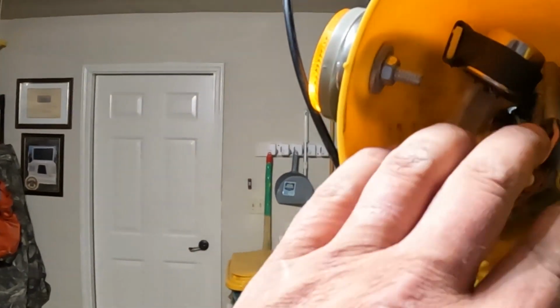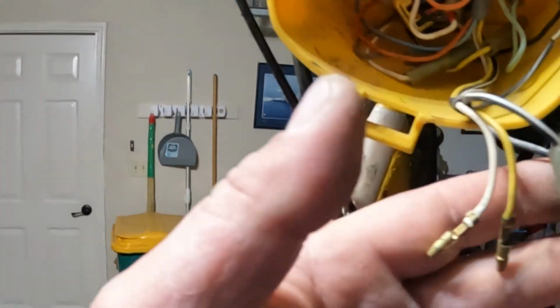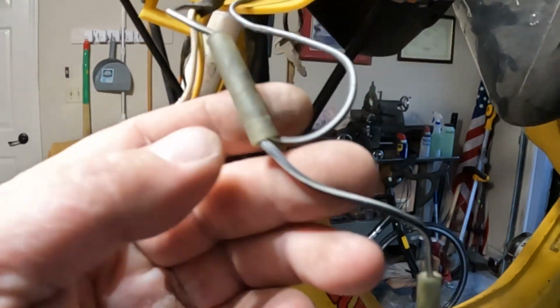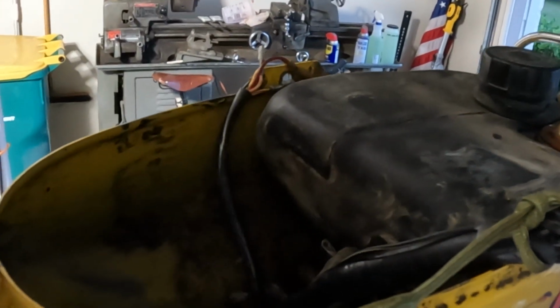All right, I got everything hooked up in here inside the headlight bucket. Hopefully all those connections are good. That's the turn signal relay. Headlight will get hooked up to these wires right here. I did find the ground. It was just a little pigtail that was on the other one. Everything back here hooking up is just plug and play. It all just plugs in. There's nothing fancy going on, but you're all gonna have to find out about that in the next video. I'm gonna get it all hooked up and we'll do the test and see if we got a spark at the ignition and at the spark plug and see if my right rear tail light works again.